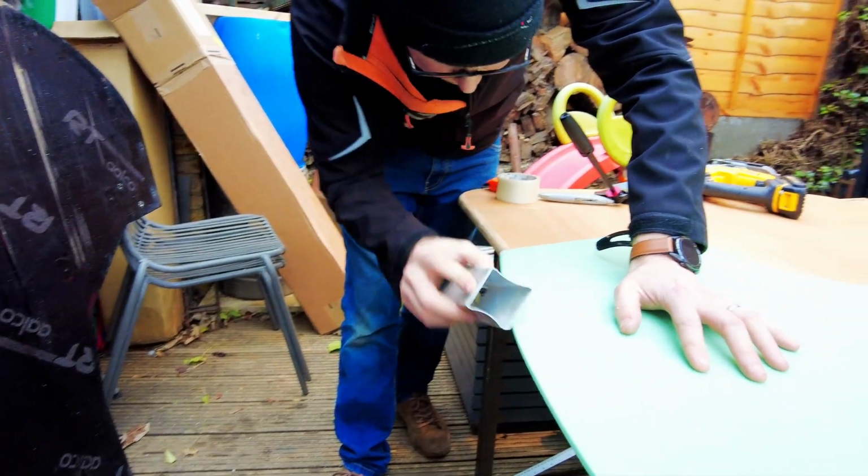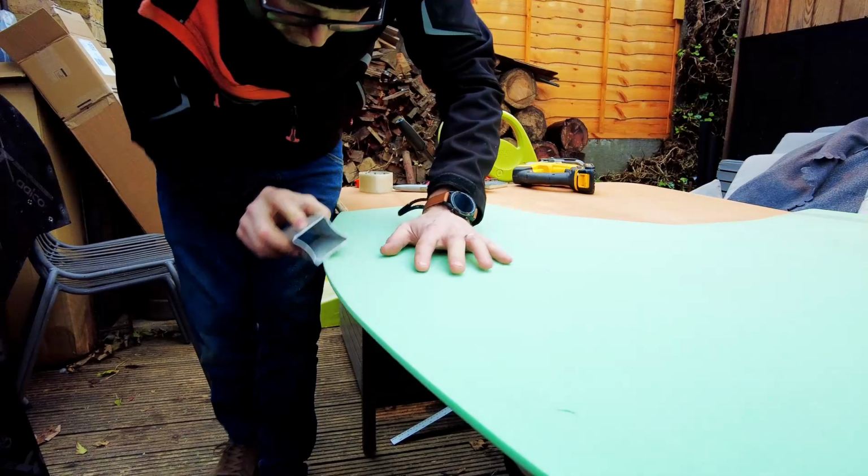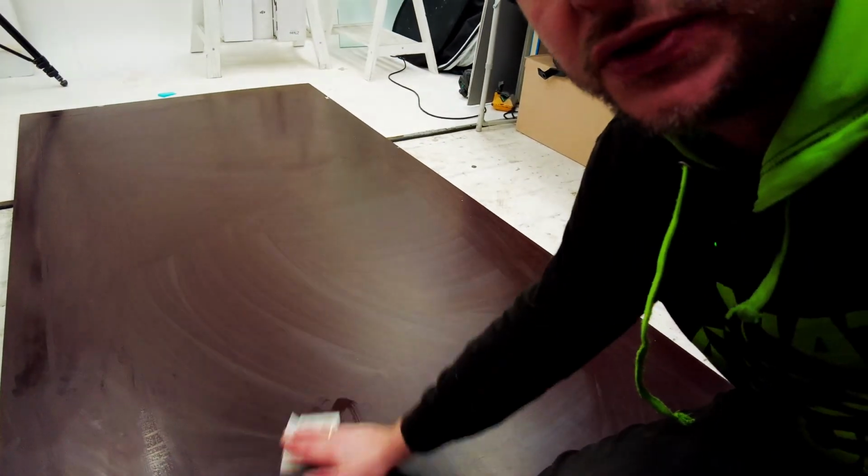As I mentioned before, we need to prep your mold or surface, whether it's glass or phenolic ply, with release agent of some sort. I'm using chemical release agent. You can use PVA or wax, and then you need to apply multiple layers. In this instance, I have already applied multiple layers before, and that's why I really like using chemical release agent, because it stays on your surface for quite a while. So all I need to do is actually renew it with another maybe 2 layers.